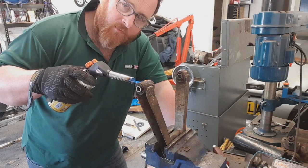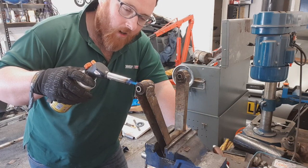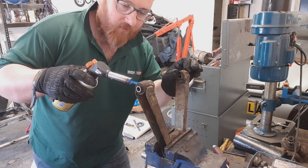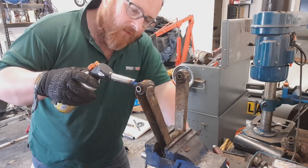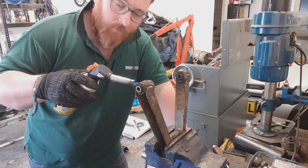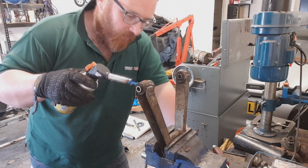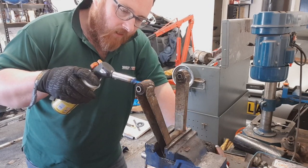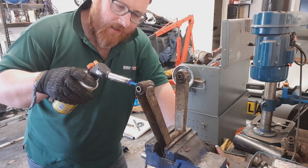The upper rear wishbones are probably the smallest ones you've got in the whole car. That will be a very easy one to chop and pull out because there's very little meat holding it in. This one will probably take a bit more effort. The biggest issue you're going to have is securing this guy, because if you're going to be hammering it you don't want to distort it, and there's very little meat in this to clamp.